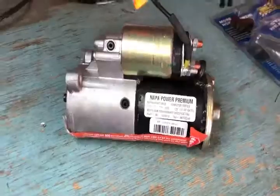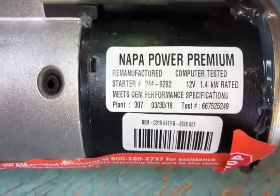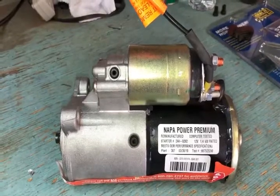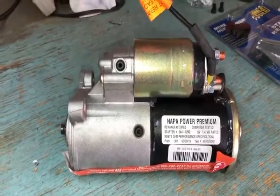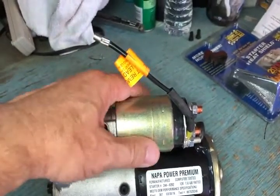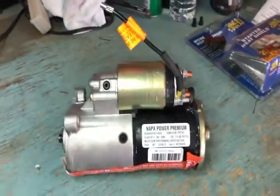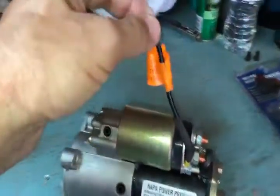Here's a brand new starter for this Ford V10 — the NAPA part number is 244929-2, the exact same starter that was in the coach. NAPA did a warranty exchange, no questions asked, and had it in stock. This here is the starter solenoid, which is what we're concerned with. The old Fords used to have a solenoid on the fender, but now everything is combined into one unit, as on most new vehicles.